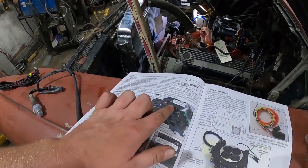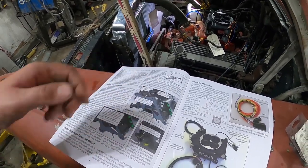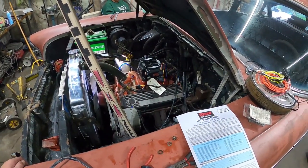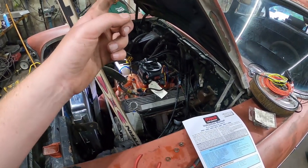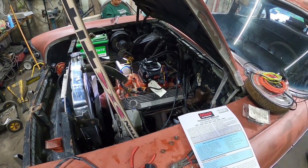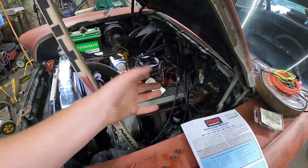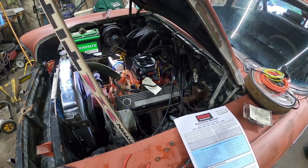It tells you exactly what to use for vacuum: for the booster, for the transmission, for the distributor, and all that stuff. This one does have a bit of a goofy thing because it has vacuum wipers, but it is teed together with the transmission, I believe. So I might just have to make that together into a T and be done with it. You want constant vacuum for that, ported to the distributor. PCV, I don't even know if this thing has got just to that intake, because it's an old style motor. So I'll run that in there. Cap the rest.